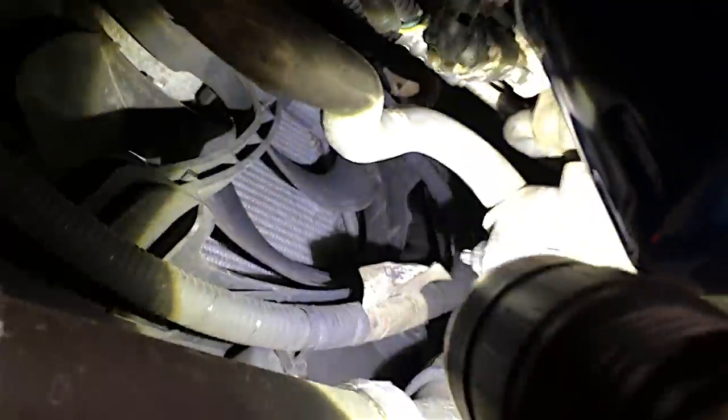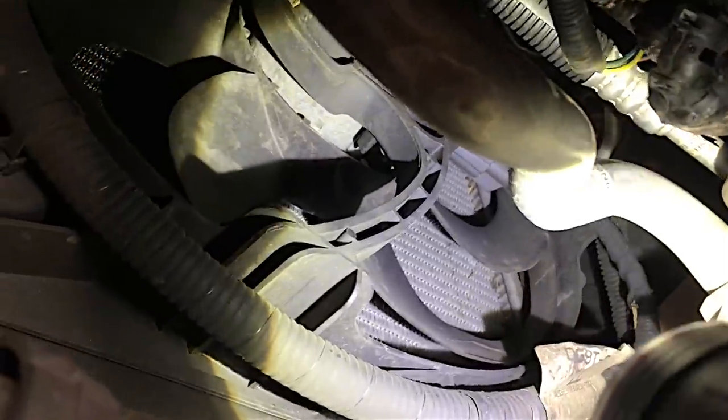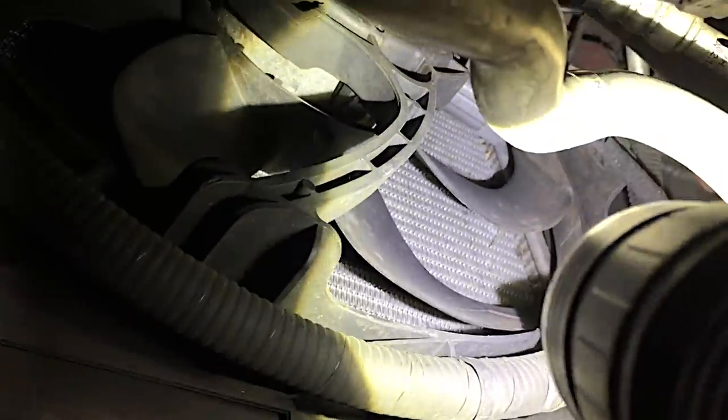I'm going to work my way around. As I get to the radiator, have a good look up there where your fans are. Look where the radiator core meets the end casing. These radiators do have a tendency to leak. So you could see the pink coolant running down from there, or building up, crystallizing. And obviously look for any water leaks on your lower radiator tray here.